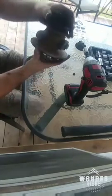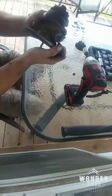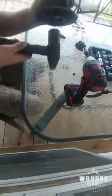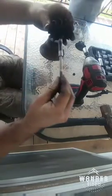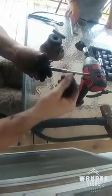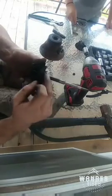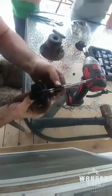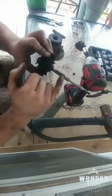From here you're just gonna pull the exhaust wheel shaft right out - may take a little persuasion. Now you have the exhaust wheel and the shaft out. I don't know the history on this turbo because I just got it from a scrapyard, but it seems to look really well. It may have needed an oil change more often than it got, as you can see the burnt oil on there, but other than that it looks pretty good.